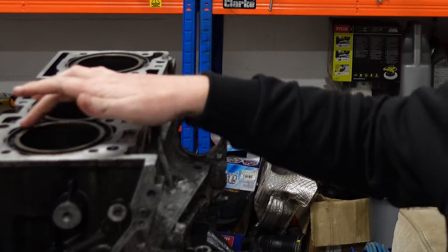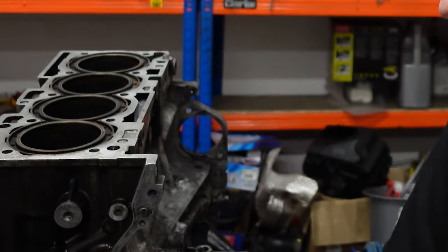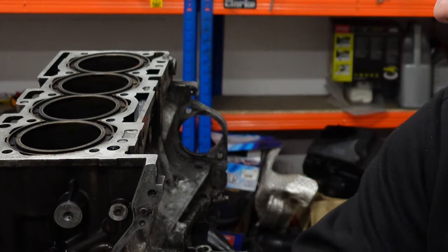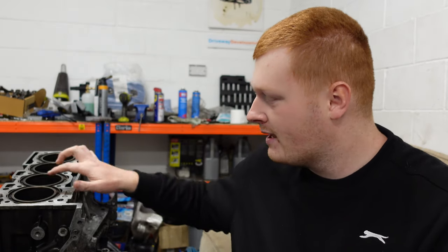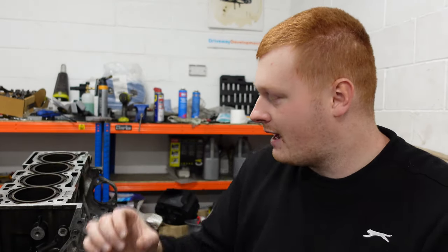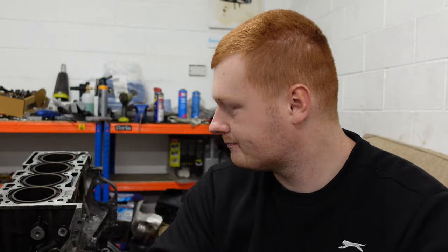Here we have a Darton sleeved block — the aluminium sleeves have been machined out and reinforced steel sleeves pressed in, so this engine is really capable of making a lot of power. But on the standard engine like what is in Stevo, the sleeves are aluminium. That aluminium physically has to hold the pressure in the cylinder, like a balloon. Over around 600 foot-pounds of torque, you're making so much cylinder pressure that you're at risk of severely cracking those bores — the aluminium can actually crack and basically ruin the engine. So 600 foot-pounds is the max safe power for those sleeves.